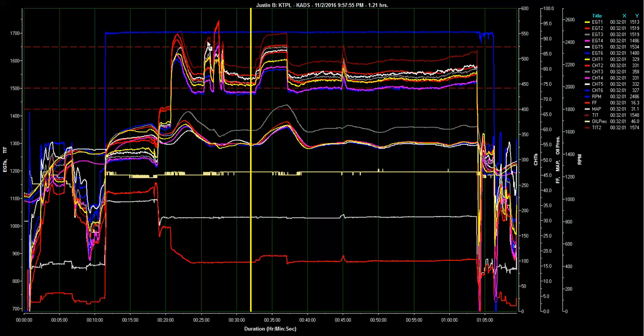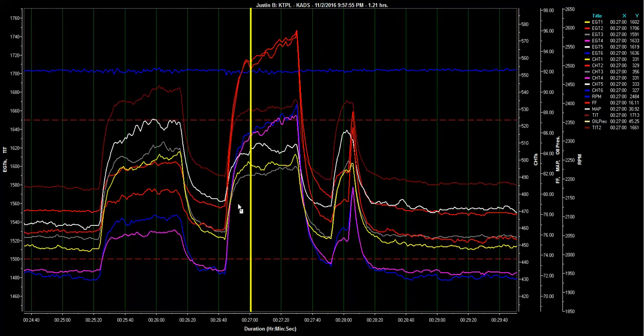We talked about the mags earlier. Here's your mag check in-flight in this area right here. I'm going to scroll in on that. You can see how bad that was running. The in-flight mag check here, lean to peak, just showed it was in craptacular health on those mags — a great variance between the two. You're essentially running on one mag versus the other one. The timing is way off on one of those mags, so you need to get those 500-hour inspections done as we discussed earlier.